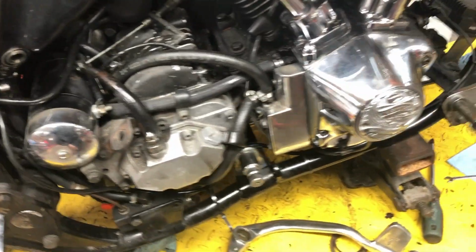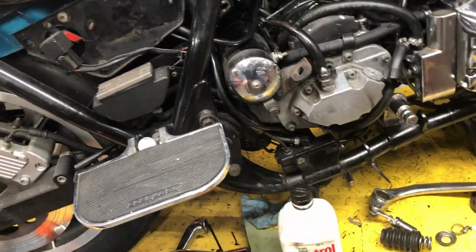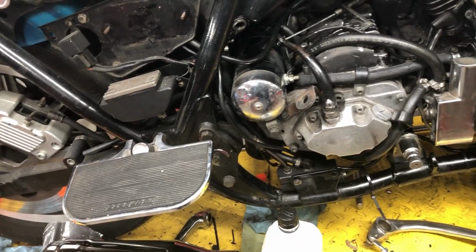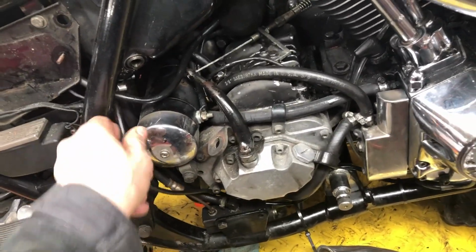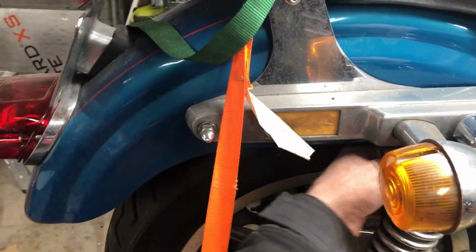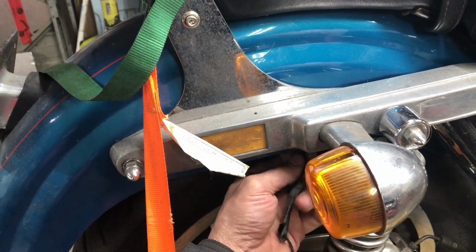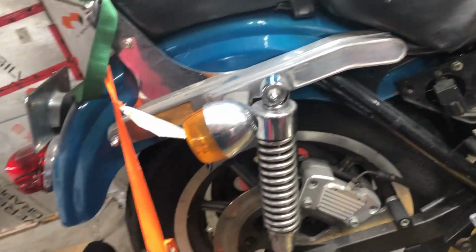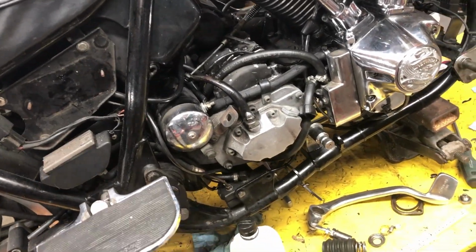And I'll take this cover off. Clean the tappet screen. Pull the oil filter off. It's down there. Get this all flushed out. I got to still solder the ignition wires back together here. I still haven't soldered the signal lights on. They were all installed improperly in the wrong holes. Lots to do. Too much. Yeah, I'm gonna pull that oil filter off right now. Get that drained.